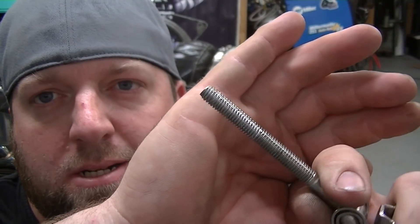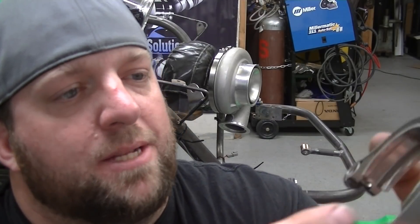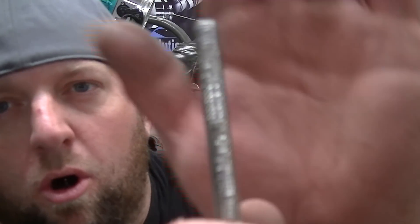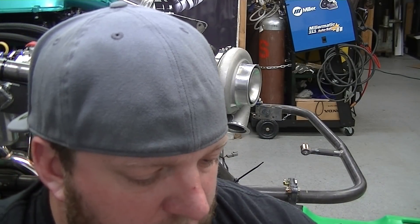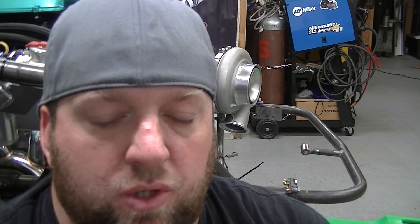China Bay headers got me — these came with two and a half inch V-bands. The V-bands feel fine but the nut just galled the crap out of the threads. Cheap stainless nut. I'm gonna bring both of them to work and see if I can just run a tap down these threads and hopefully save them so I don't have to buy new V-bands.